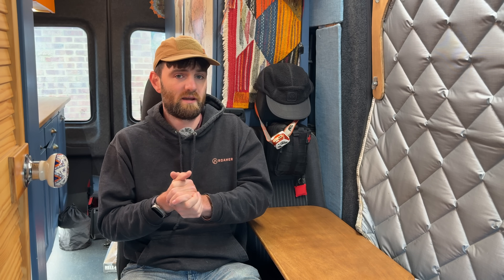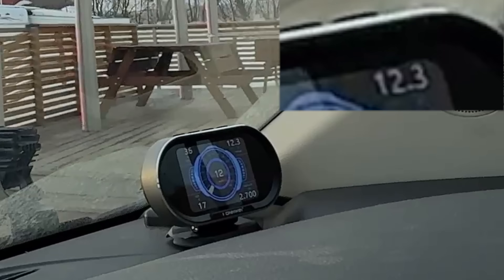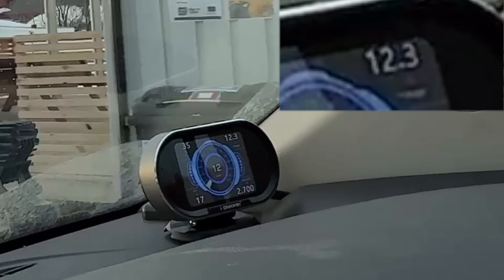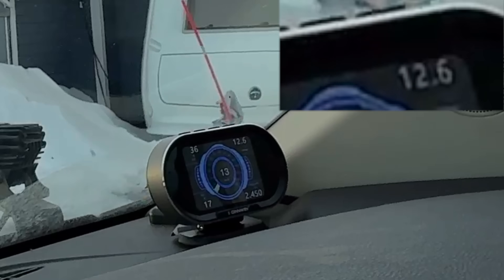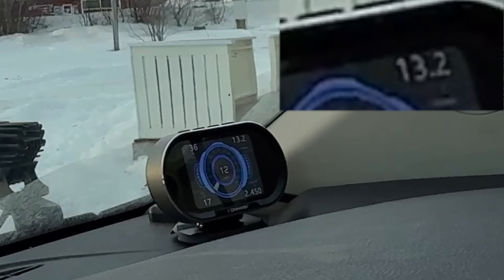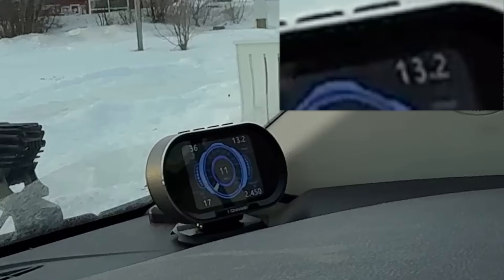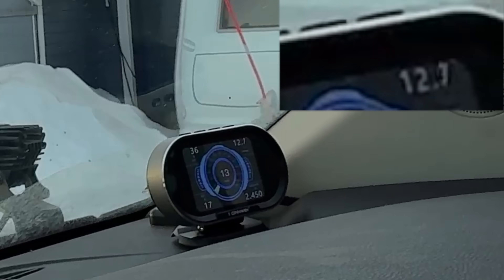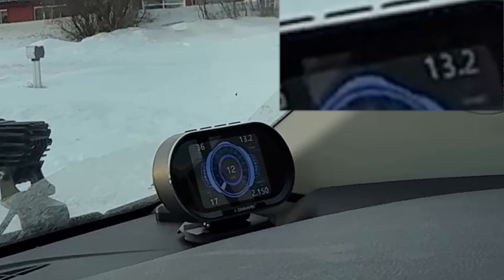There are a number of ways to activate the smart inhibitor — the official Ford way, which we're going to see in the video. Here's an example: whilst I'm driving, the ECU believes the starter battery is fully charged, so it's dropped the voltage and cut the alternator output. As soon as I turn on the lights, the vehicle knows there's an additional load and the voltage rises slightly. I get a little more power from the alternator, but not enough to have the chargers running at full. This is functioning exactly how smart regenerative charging should work — but it's being a little bit too smart for my use case.